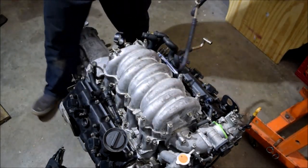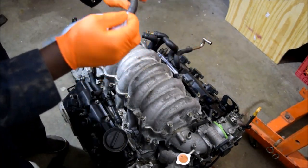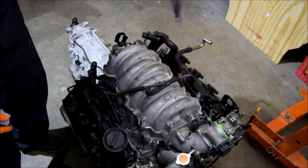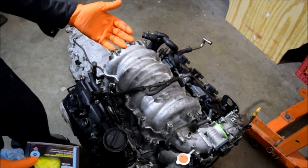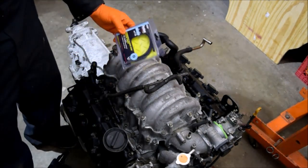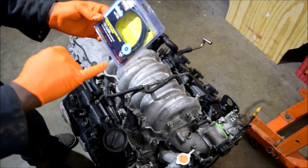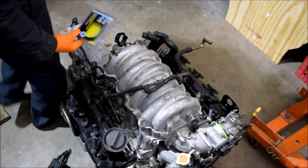It's maybe not exactly 100% soft and subtle but it still bends when you ask it to bend — that's been tested. Just wiping some oil off to give it a fighting chance going in. I'll need my pliers. This here is vacuum tubing and that will come into play. The small diameter tubes don't seem to hold up as well as the larger ones — they break a little easier. I got this Preston tube from O'Reilly's; the number is WV-0532, windshield washer hose, and vacuum tubing 5/32 diameter — 4 millimeters ID.